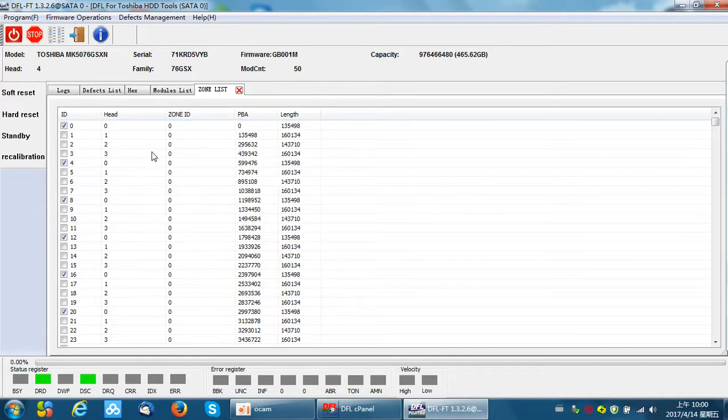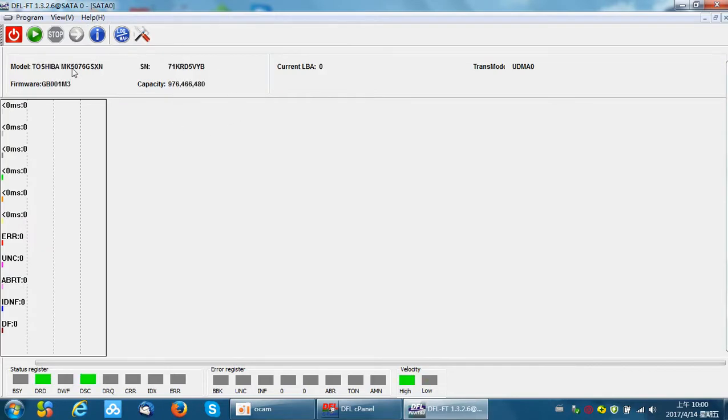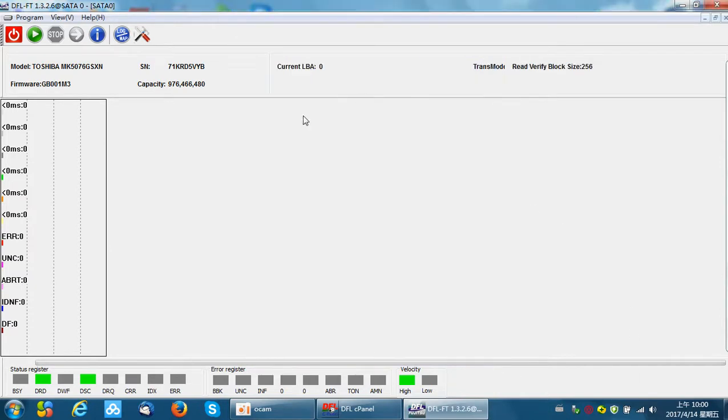Cutting head or cutting zone is very easy. After the zone or head is cut, users can exit the program and go to bad sector scan. Users can also try to zero-fill the hard drive, then power off and power on. Usually, the hard drive is refurbished at this point. Sometimes users can also reset the SMART before cutting head or cutting zone — this is also a good suggestion for Dolphin users.